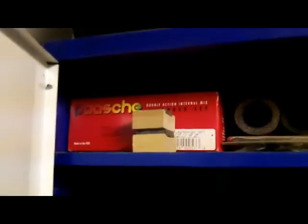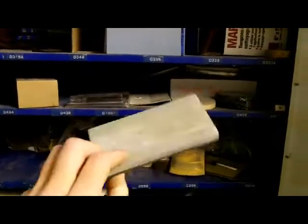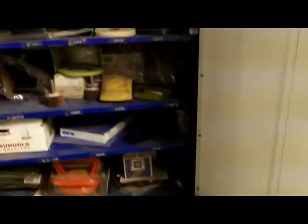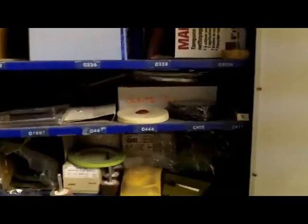So anyway, my airbrush. I might mess around with that a little later today. Red Scotch pads. That one's gray Scotch pads. Some, you can't even see in there, tack cloths. Sanding blocks. Those guys are my favorite. So, firm on this side and a little softer on this side. Use that for blocking small spot areas of primer. I'd love to get a set of Durablocks, but I really don't have a $100 bill to put toward that right now. I got a Schutz gun in there.